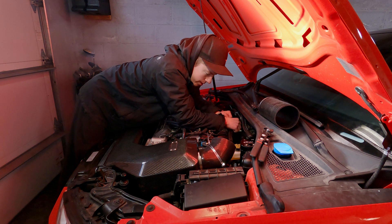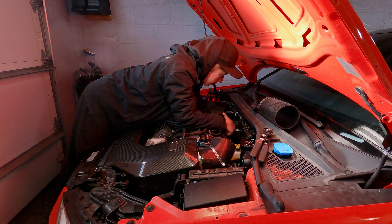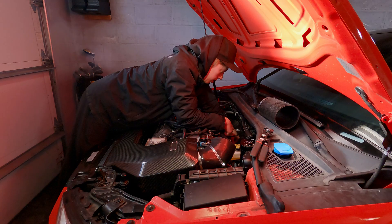I'm going to replace these lines and then go test the car and also double check preload on the wastegate arm. I was told the arm should just reach the wastegate clevis when it's all the way closed, and then you tighten it three full turns — 360, 720, 1080 degrees.